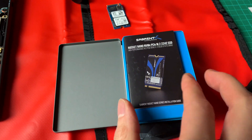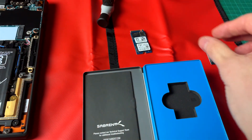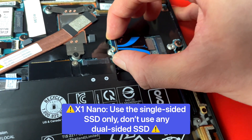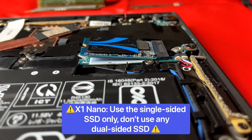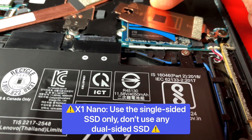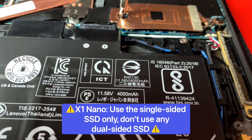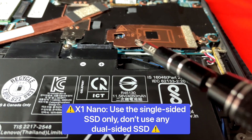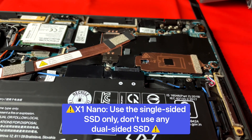So we're just opening this. On the inside we have the instruction manual. You can see it's double-sided. I thought this might be an issue, because if we look here, you can quite clearly see which one is single-sided and which is double-sided. Let's see if it works. Let's try it with the thermal pad removed. You can definitely see the drive is nudging up a little bit. If we gently press down, it's actually very close to the screw hole, but it can be inserted appropriately. The heatsink is nudging a little in one direction, but it seems a single-sided SSD is the designed specification.